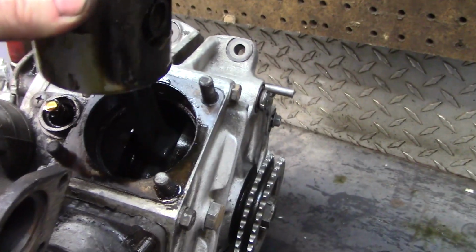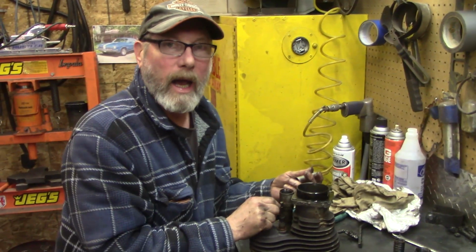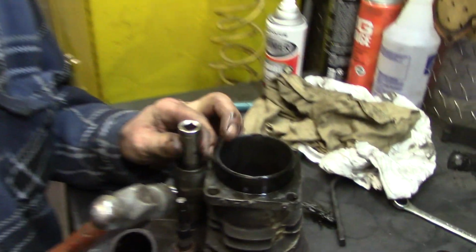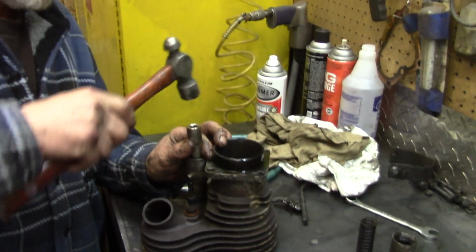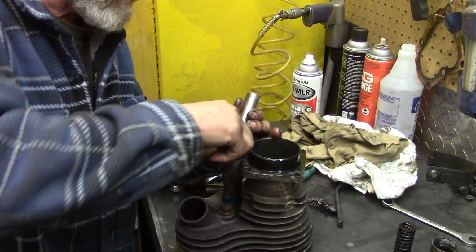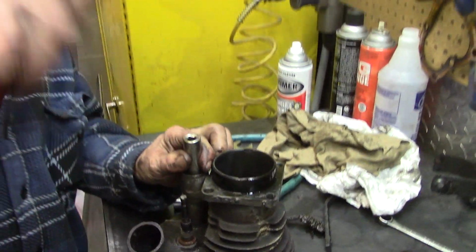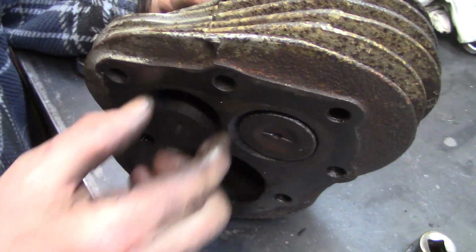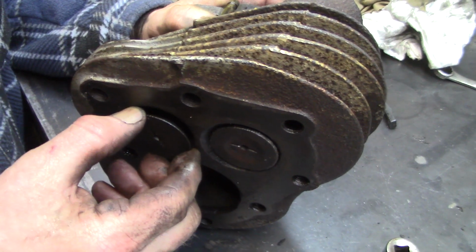Sounds nasty. Will the expert look at this? I don't have the spring compressor that fits this, and you guys might freak out that I'm doing this, but I'm just taking this, and when you hit the spring, you're gonna release the tension on the locks and it's gonna come apart. And I know somebody's gonna say, that's terrible. You got it all? 1.5. You're hitting it fast enough where it unloads that lock. Goes nice and easy through here, and then you're grabbing it and you're trying to wiggle it.